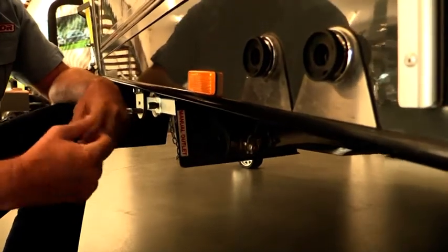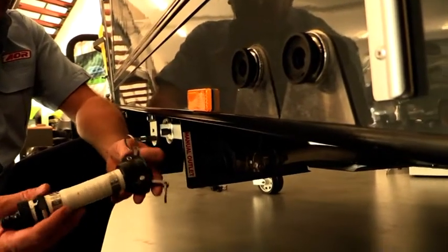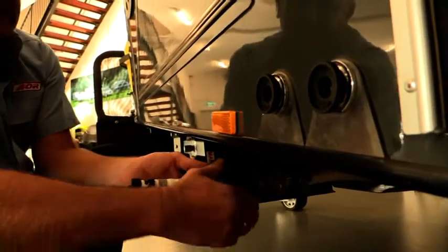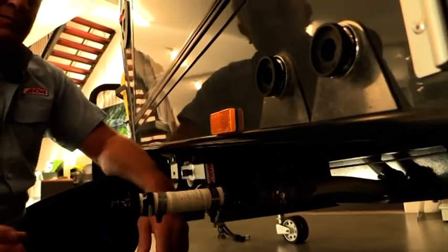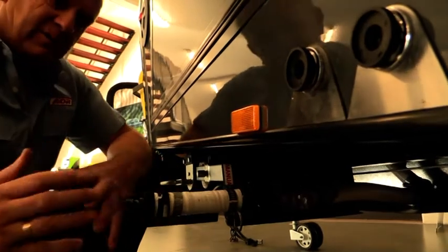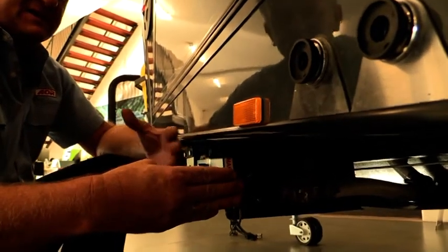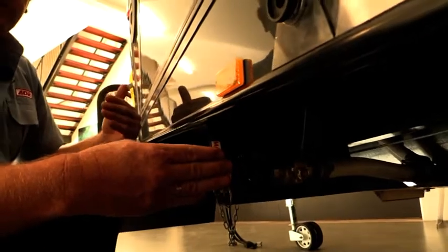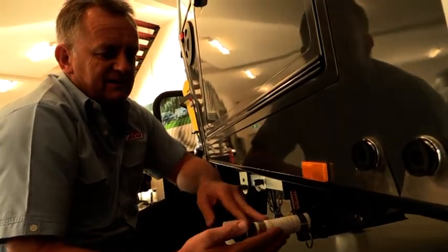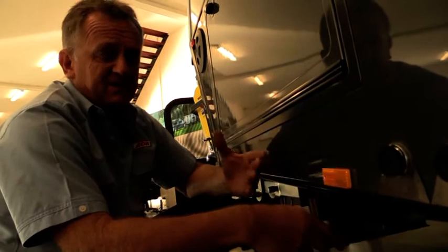Also on this point, if I want to do the cleaning side after I've drained the tank, I can do the reverse flush. By utilising our reverse flushing pipe, I would connect that onto the outlet the same as I would with the dust cover or the black hose. Connected on, I would then hook our garden hose onto the side here with pressure, open the valve again, and allow the water to flush through. Doing it this way, I'm trying to clean out anything left in the tank debris-wise, while still pumping out through our front pump-out point on the drawbar A-frame. The concerning area is that if the tank is not cleaned correctly, we can have a build-up of toilet paper inside the tank, inside the lines, or on the impeller blades of the macerator pump.